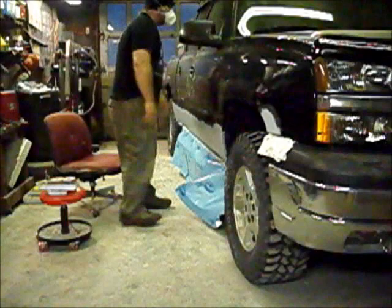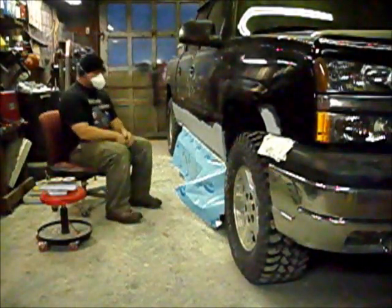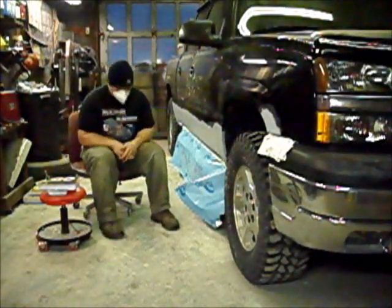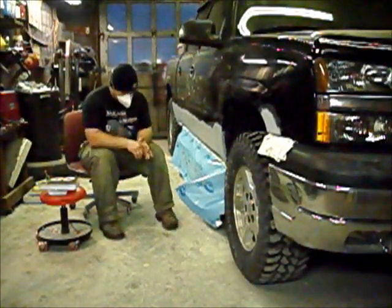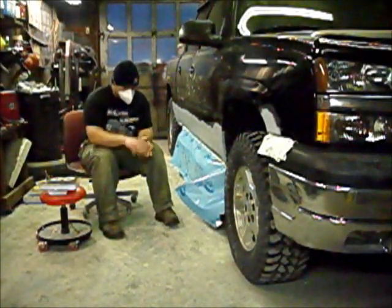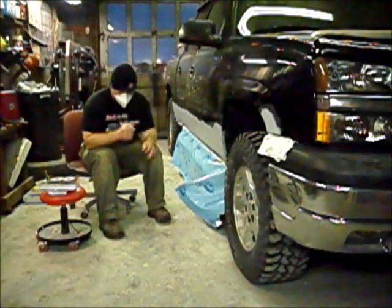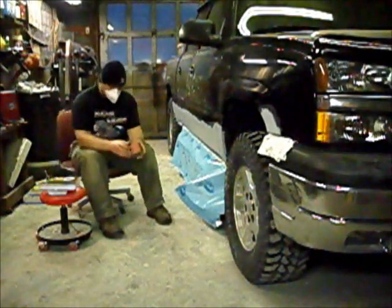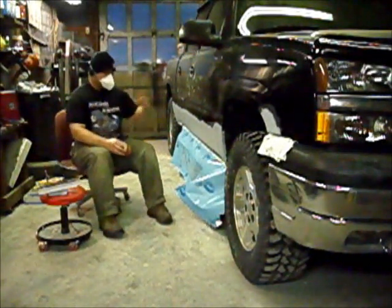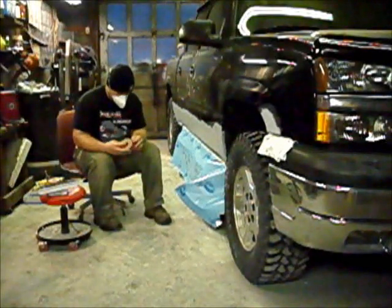Ooh, a little chilly. My kerosene heater quit on me today. Pissed me off. You plug it in, and it goes, and it just blows out smoke and quits. I've done it a couple of times. I took out the jet, blew air through it. I don't know. I think the fan and pump are starting to seize up and it's kind of old.